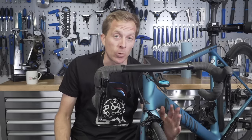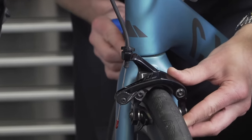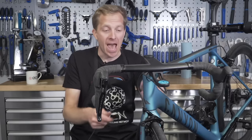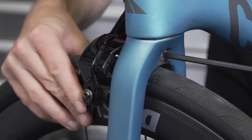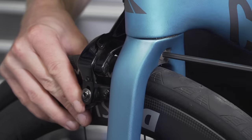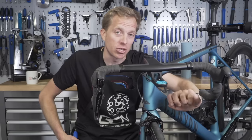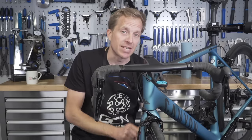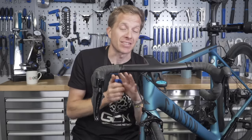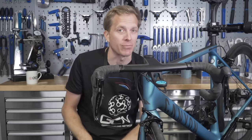In order to make sure that your brake calipers are aligned centrally, you need to release the brake mounting bolt either behind the forks or behind the bridge on the seat stays, and then line them up as central as possible by eye and tighten up that bolt. You've normally got a screw or a socket head on the actual brake caliper itself that you can then use to fine tune that adjustment. Make sure that both brake pads touch the rim at the same time when you pull on the lever — it might take a little bit of effort but it's more than worth it for perfect braking.